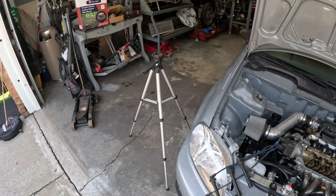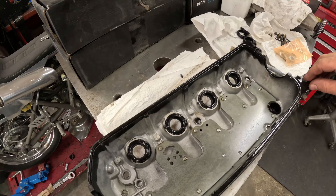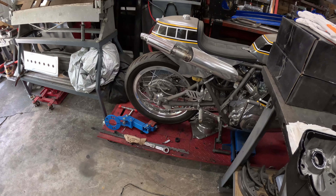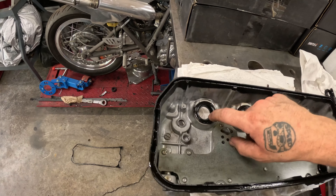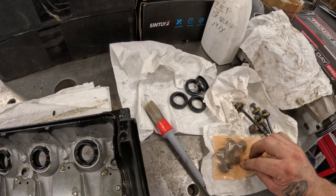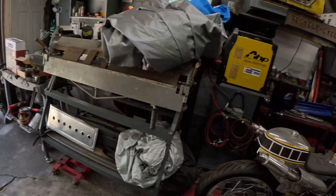I need to pull out this old crappy gasket — still fairly soft but it was leaking. I'll pull out the spark plug tube seals, which we have brand new ones for, and we also have brand new upper seals for the cover bolts. I have the new cover gasket out in the sun getting warmed up — Honda packages them all crumpled up. I'm going to change those out, pop it back on, and hopefully that oil leak is solved.